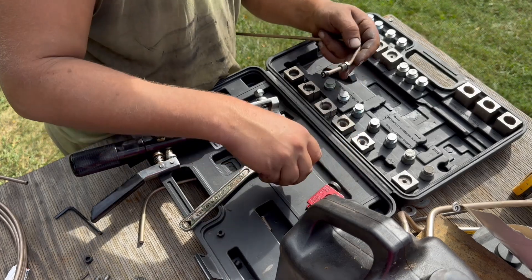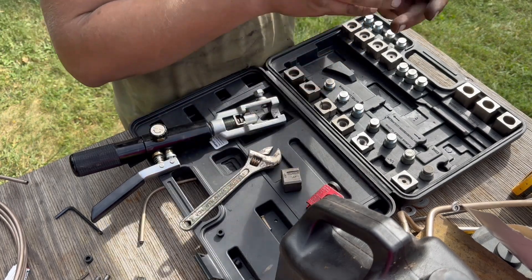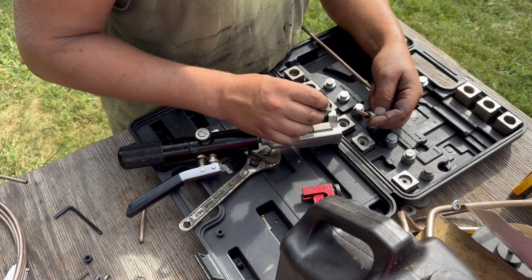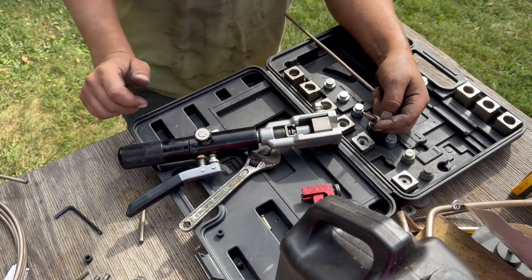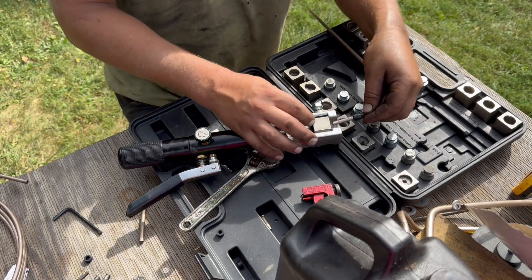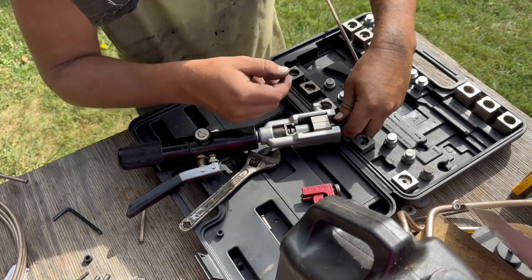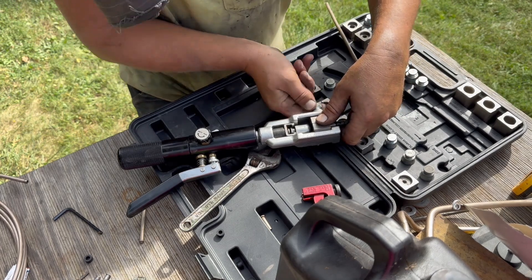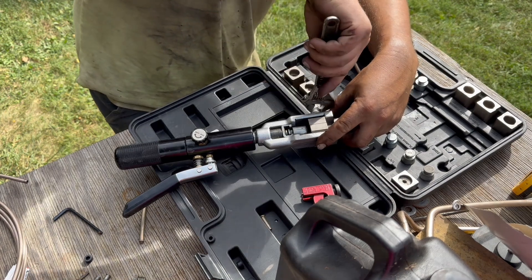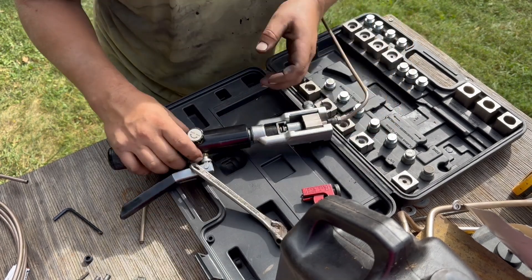With this tool I have to have enough room to actually put this block on it and still crimp it, so it's cutting it kind of close there but we should be fine. Put that on so I got enough room. Slip my die back in. This is a die for doing a double flare, but I just got the flare tip in it. Just run it through so I barely have anything sticking out of the die. Let me go ahead and tighten this up — you want it tight, otherwise you're just going to push the whole piece of brake line through.